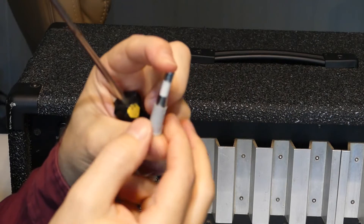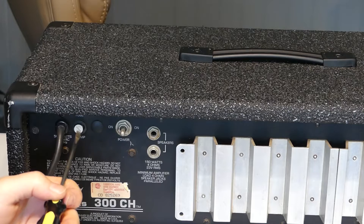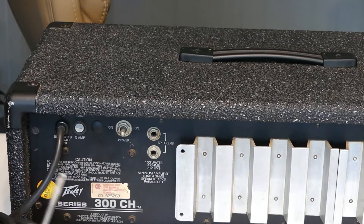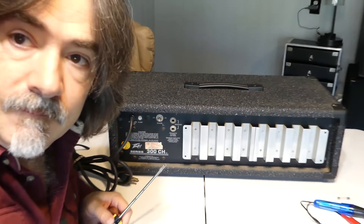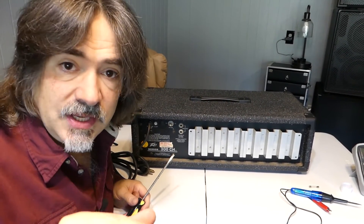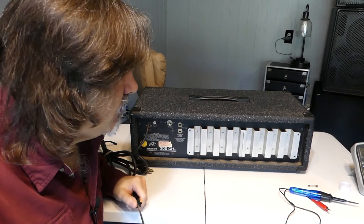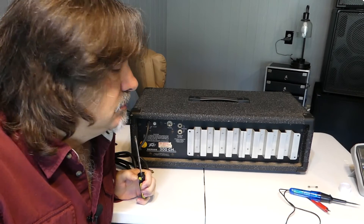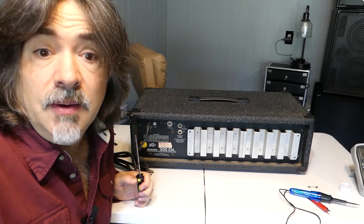Put it back in the little sleeve where it goes, and screw it back in — this one just screws back in nice and snug. Usually there's a little spring in there so you have to push on it to get it to go in. If you've got the little tray type, simply take the old fuse out of the tray, put the new one in, slide it in, and it'll usually snap into place. Once it's secure, the fuse is replaced. That's the gist of it — real simple. First thing you check when your amplifier won't turn on or shuts off unexpectedly. If it seems really hot, it's probably a thermal breaker that blew — usually they'll come back on automatically.